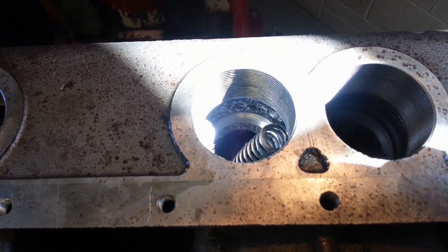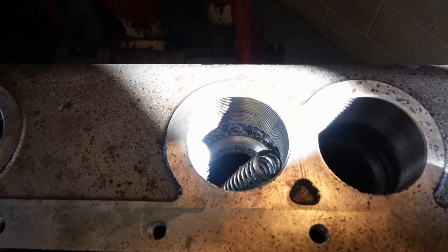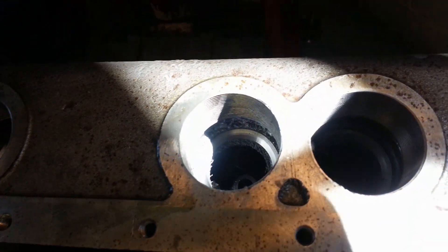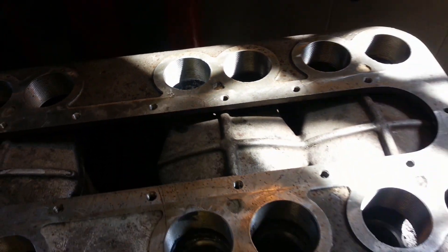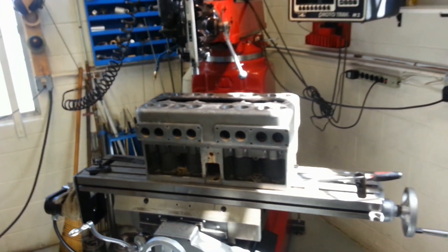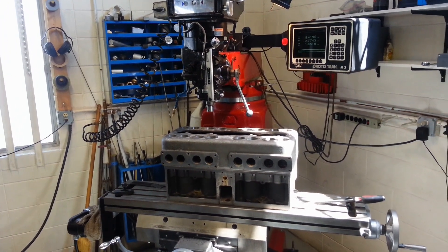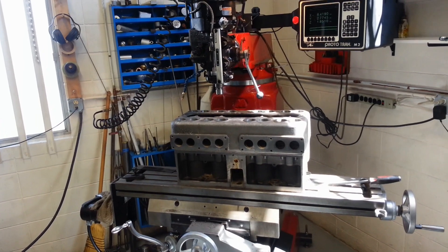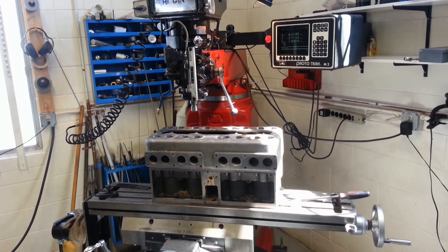There's the finished seat. You can see the three angles on there and the seat width is controlled. I'm running a fairly thin seat, and the reason is that the spring tension is so low that it helps to have a thin seat to get your seat pressure up. It helps with sealing, and we'll do a vacuum test on everything before it's all done. There we go — there's our valves and seats, and our guides we've already honed and finished. I didn't video those but maybe next time. Hope you enjoyed — ask any questions you'd like, happy to answer them.